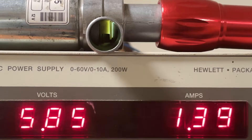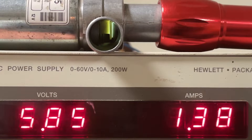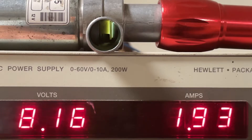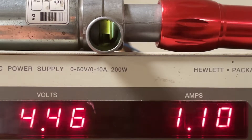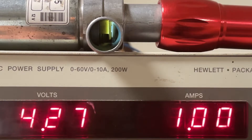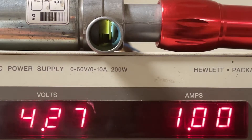So these things must have had some other control units, or they were adjusted with the spring the wrong way. What you're seeing now is basically closed — open, close, open, close — but at 990 milliamps or 1 amp, this unit is not closed. That means you would have to adjust this with the spring, pulling the spring out so that it is closed. This will idle at 1,000 RPM as it is.